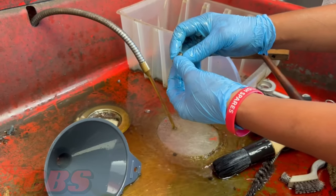I found it — the level in the oil tank should be an inch and a half below the filler cap. This is not for all Triumphs — this is for the unit construction models that do not have a dipstick on the cap. So if you guys have one of those caps that hasn't been upgraded, keep that in mind: inch and a half below the filler cap. We're going to put a little bit more oil in, then we're going to measure it. We have our caliper here — you could probably use a tape measure. We're just going to stick it in here; it's set below the filler neck. It doesn't have to be perfect — we'll eyeball it. So now that we have the oil back in the oil tank, I recommend actually starting the motorcycle and checking to make sure the oil is returning to the tank. If you removed the sump plug from the bottom of the crankcase, make sure you bleed the engine if necessary to ensure you have oil and no air in the line. Let's start the bike up and check the oil flow — after that we can call this job done.